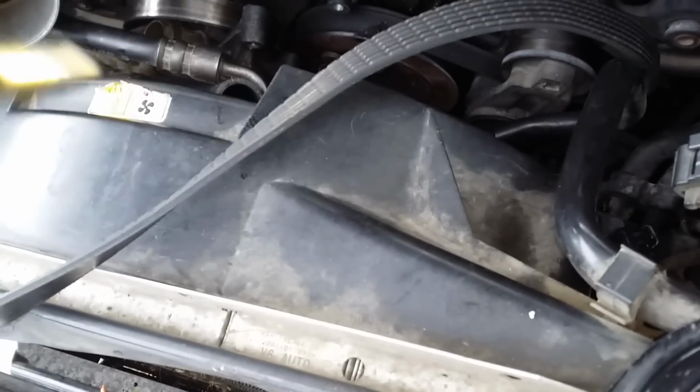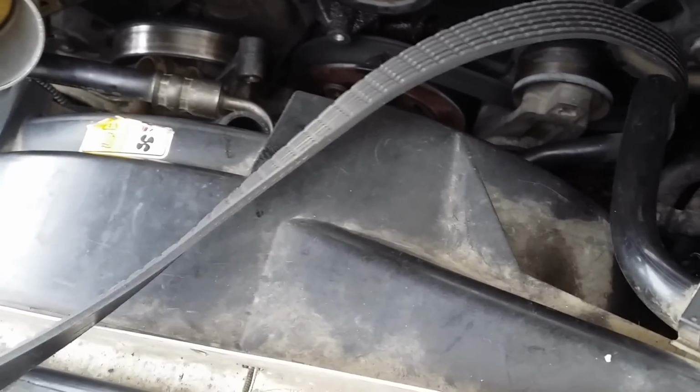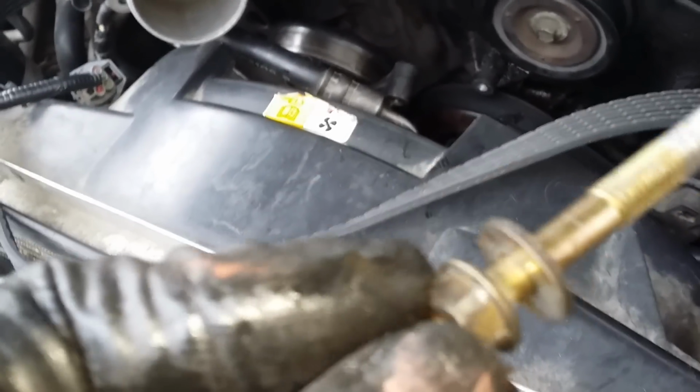I haven't done this before with the water pump. This is my first time. But what I've been doing is taking these pieces out, and each time I take one out, I put it in that exact spot on the new water pump, just to make sure that it's going in the right spot. Because I know also the holes might be threaded differently, even though these might look exactly the same. Two of them look exactly the same. I have another one like this on the new water pump, but they might be threaded differently. So if I tried this in the other hole, it'd probably be difficult going in. I don't know, but it's a possibility.